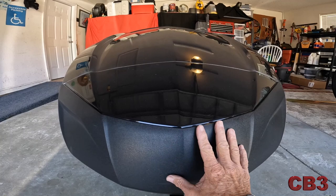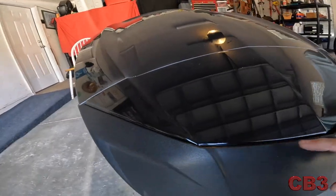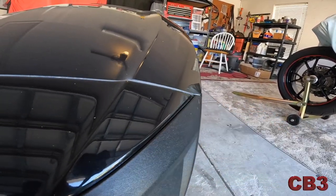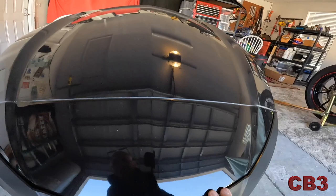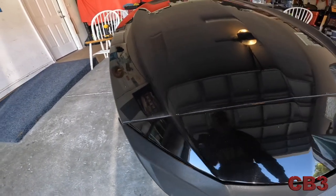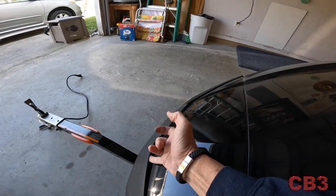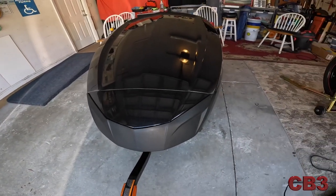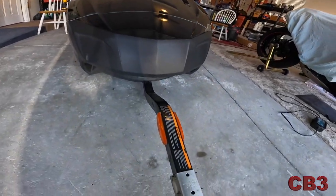Really, really poor — this should have never gotten through QA. It was put on kind of cocked a little bit too. You can see your gap here — that's a quarter of an inch versus your gap here which is not a sixteenth of an inch. Because this is cocked down and this is cocked up, and that's not in the center, this sits nice and tight on one side and then there's a small gap where they bowed it out to try to get it to line up. I can almost stick the end of my finger in that gap. So that's pretty poor — it was that way from the day I bought it. It wasn't a deal breaker for me, it was the only trailer within 200 miles.